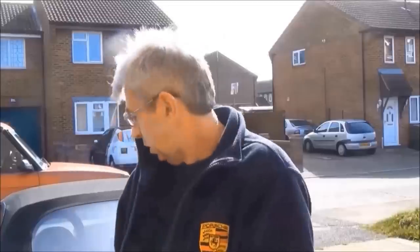How you doing? Today I'm round at Dan's. He does most of the mechanical work on the Porsche for me. I've been having a bit of a problem with it kind of jerking, hiccuping when you just come in off the throttle and going back on, that kind of transfer period. So what Dan suggested we do first is have the throttle body off and give that a clean out. So we're going to get the roof down and get on with the job.